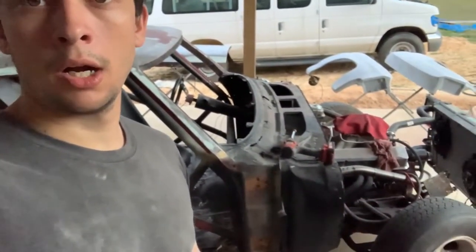Good afternoon, guys. So yesterday, after I finished blocking out the quarter panels and everything, I just went ahead and called it a night. I was pretty tired. Had a doctor's appointment this morning, so I didn't really get to do a whole bunch this morning. I did go ahead and sand the fiberglass fenders, which I didn't film, but just ran over those really quick with a DA sander. They're sitting right over there. I didn't really find much on those, so they're actually fairly straight. I did do a little bit of a skim coat over a couple little tiny spots, but nothing major.